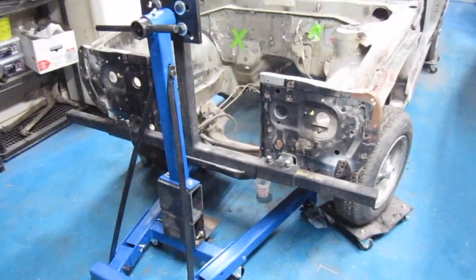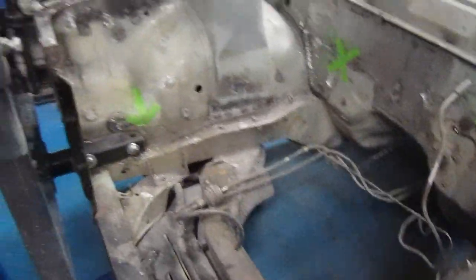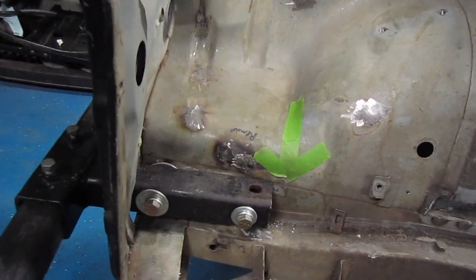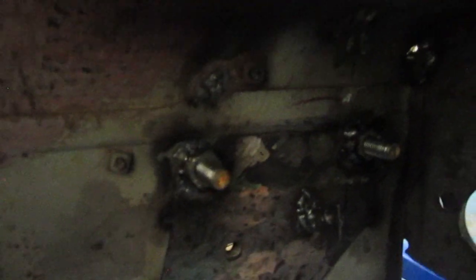The other engine stand is now attached on this side. The next step is linking them together once the car is fully stripped. I drilled through the bracket and ran bolts. I also cut out the old weld nut, drilled it up bigger, and welded on a new nut — that should be a lot stronger. It will also work with my bumper; I might have to make those holes a little bit bigger, but it'll be good.